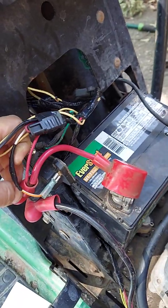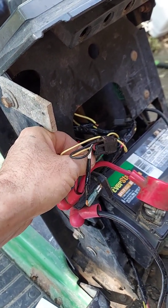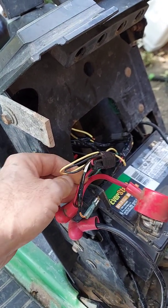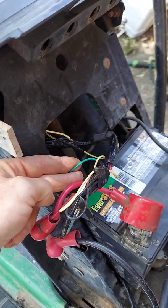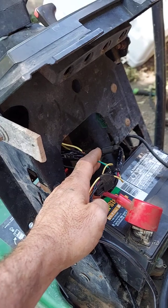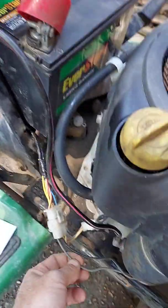The positive side of the solenoid — I run power to my key switch, which is the B terminal on the back of your ignition switch. B terminal is power from battery. G obviously is ground, which runs to the back of my key switch to ground. So that sends power to your key switch — you have a hot and a ground. With key on, it sends fire to the L terminal. The L terminal I have running to my fuel solenoid.